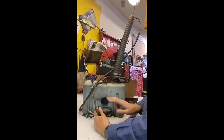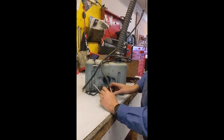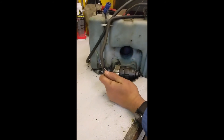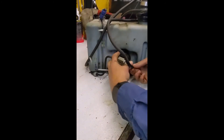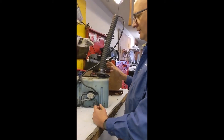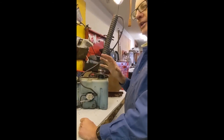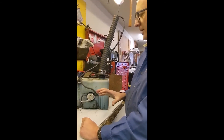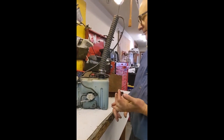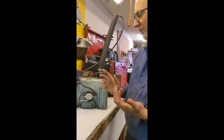These motors are quite often all rusted — I think they're over $200. As you can see, this hose is not put in right, there's a kink in there, that could cause a problem. Mainly the problems of oil injection are in transferring the oil from the boat to the motor. It'd be much better if they could put the whole tank on the motor — Suzuki does that, the new G2s do that. It's much better but it takes up a lot of space inside the motor cowling, so that's the reason they can't do it.